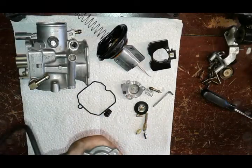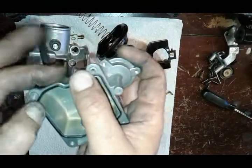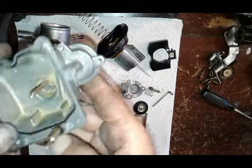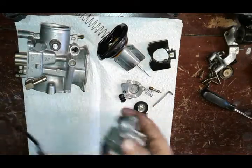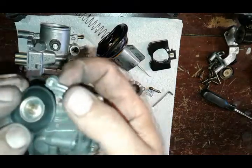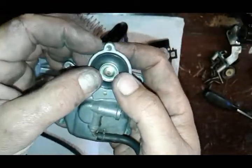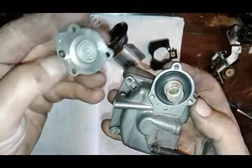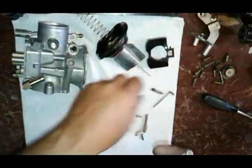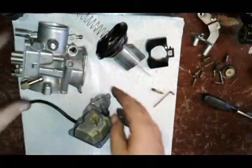So now what we're going to do is replace our gasket. For less than 20 dollars it's not worth it to skip this and risk doing the job twice — it fits nicely right in. Next we can put our diaphragm in — there's one side that has a groove, so that fits right in there. Next we're going to put our spring over the top, and next we put the cover making sure the o-ring stays in place. Then we can put our new boot over this little part.